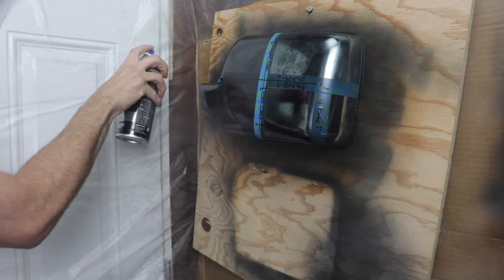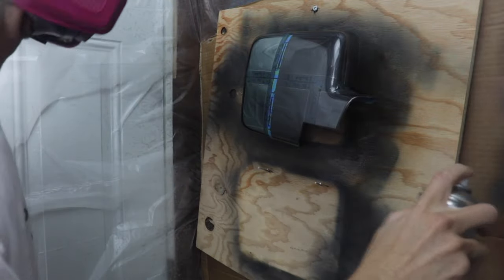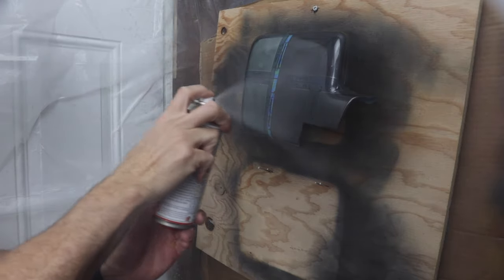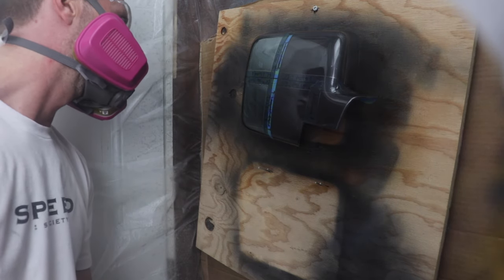Next is 2k clear on the other mirror cover. Now 2k clear is a urethane and generally you're not supposed to put it over acrylic lacquers like Shadow Chrome — you're supposed to wait three weeks to let the lacquer gas out. But a lot of people online say they've done it with no problems, especially right after applying the lacquer. I'll post a pinned comment in a few weeks to update you on whether any issues occur. I really love the wide spray pattern and smooth output of the 2k clear, but I highly recommend wearing a respirator — it settles everywhere and can cause clear coat fallout in your garage, so use a paint tent.